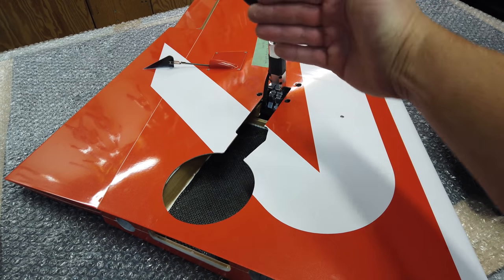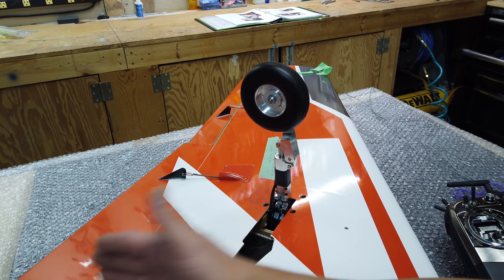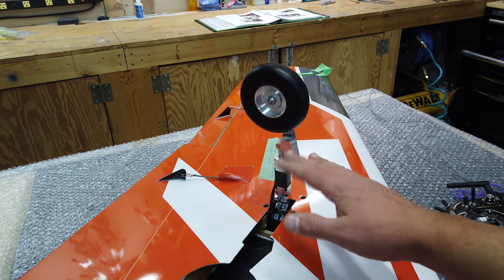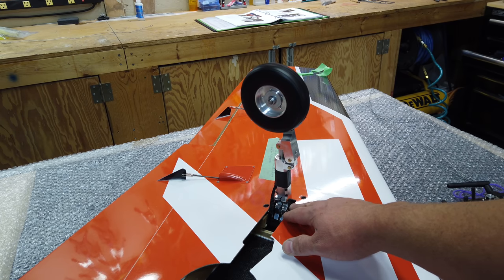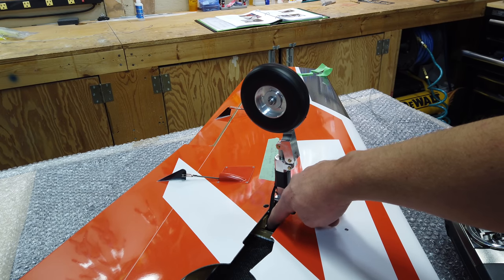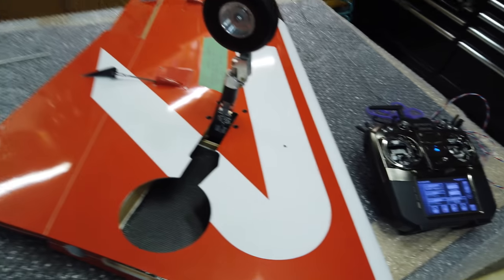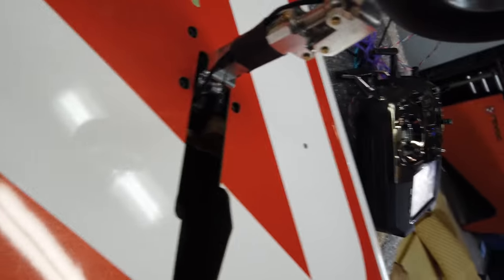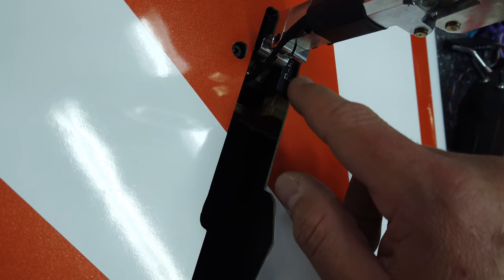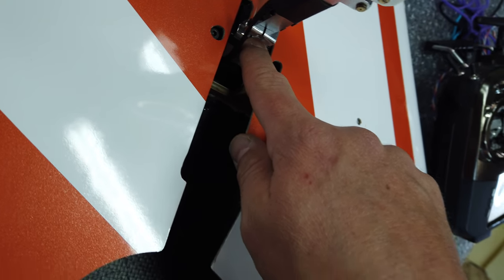Awesome — at this point I can't adjust the toe-in and get an accurate measurement because the wing angle isn't flush since the fuselage isn't straight. I'm just going to snug these up roughly so I have an idea of where it needs to go. My primary concern right now is that this brake line doesn't interfere with the way the gear works. One point to be aware of: with these pinch bolts on the gear, we can't actually access the bottom one with this gear installed, so I do need to pull this gear out and tighten the pin inside the trunnion.